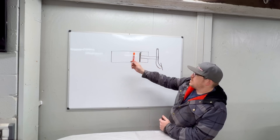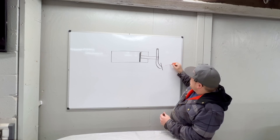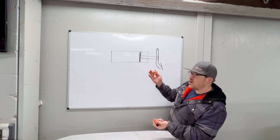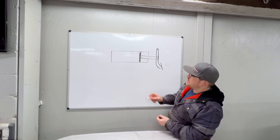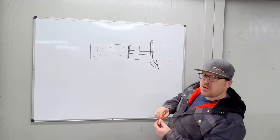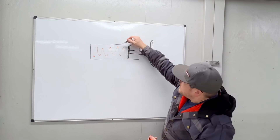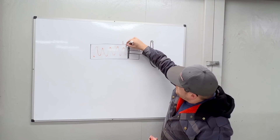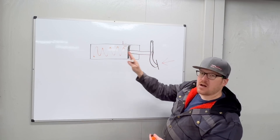I have a quick diagram here to represent our master cylinder — a simple piston, rod, brake pedal with an upper pivot — where we apply the force of the brake pedal to move the rod in and out. During the whole service life of your car, you only have so much travel on your brake pedal. Say you can only move your brake pedal to a certain point before the fluid compresses and your brakes lock up. So that seal is only moving back and forth in that zone, keeping the bore clean with a nice surface because the seal is constantly rubbing and working it.